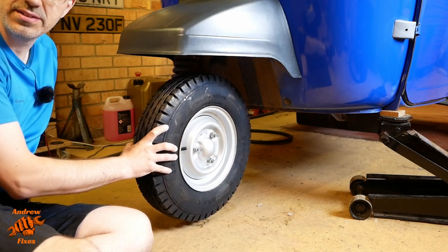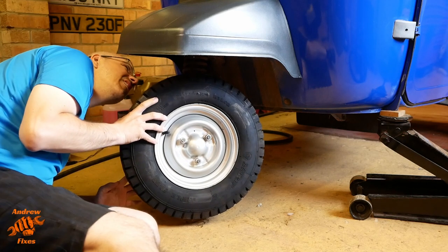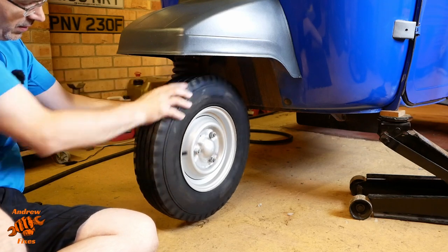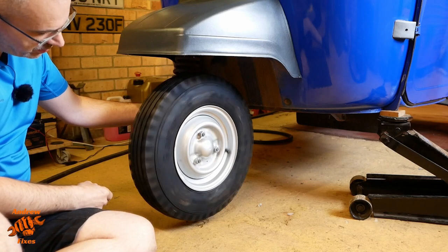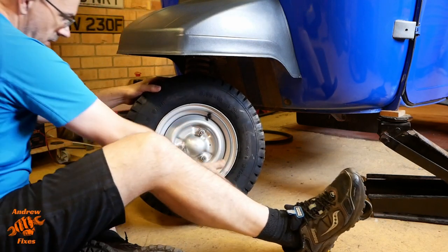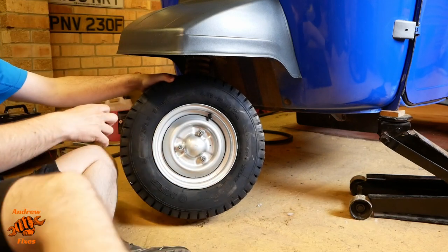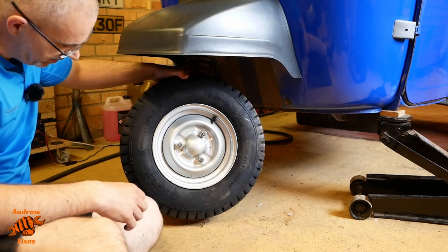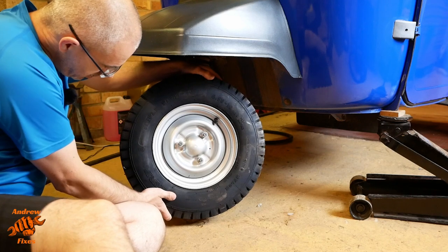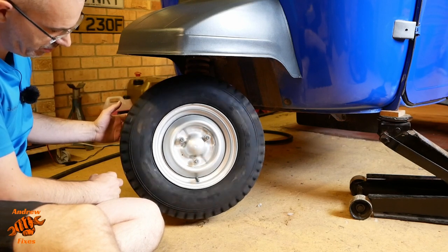That screeching is just where the steering tube goes into the cab. We can check that both lock stops work — which they do. While we're here we can give the wheel a spin, checking for the trueness of the wheel and listening for wheel bearing noise. Another way to check the bearings is to give things a little bit of a rock. There's a tiny bit of play there, but a little bit of play is preferable to them being too tight — I don't think that's excessive, not actually causing any visible movement. The other reason for doing this is to check that the brakes aren't binding, which clearly they're not because it's spinning really nicely and freely.